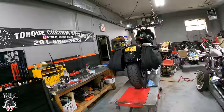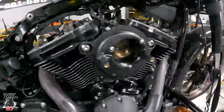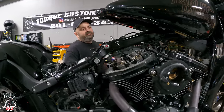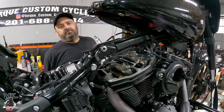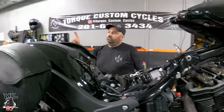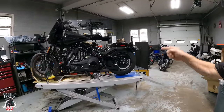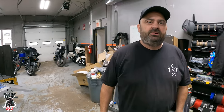There he is. So we got my bike here. Apart again. Anything yet? Yeah, so what we're thinking is we've got a lot of play here. But how about the other ones that you've done? So we took this one apart at the same time. It's more apart now, but we measured the differences between the clearances on that one and that one, and you're over 10 thousandths more.